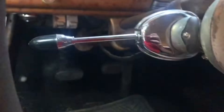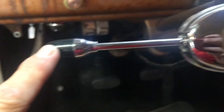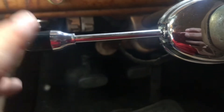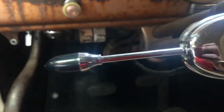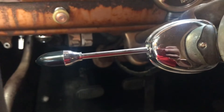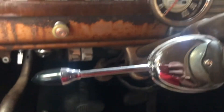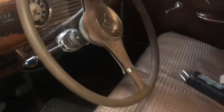I've also ordered a new turn signal switch — this thing is already on the fritz. The light stays on all the time and ran my battery down, so I had to take the bulb out of it. The new one has a four-way hazard switch built into it, just in case that might ever be needed. So some upgrades are getting ready to happen, keeping working on this project little by little.